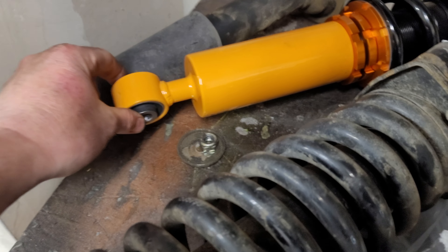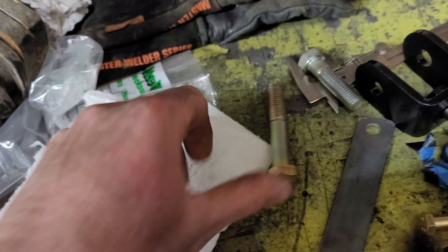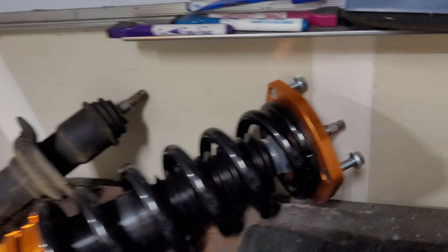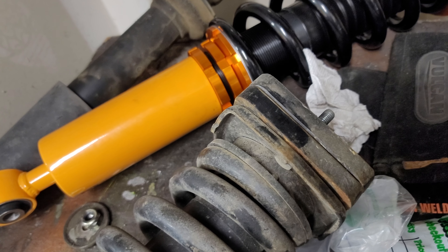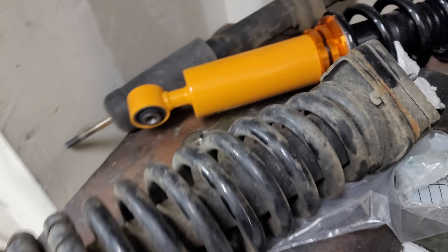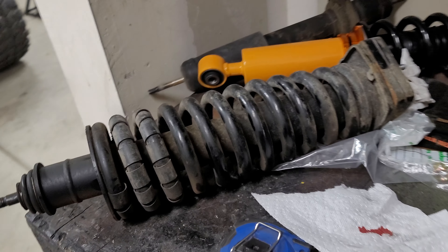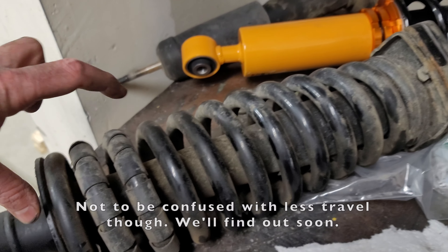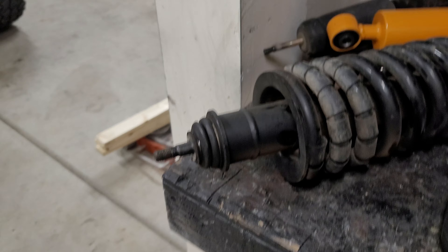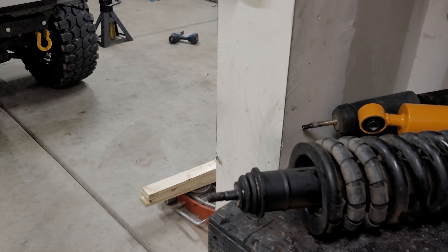Had to do some modifications — waller out this hole a little bit to effectively use good Grade 8 hardware, half inch bolts. Remove the top plate and install the factory Mercedes one. So no more blocks for me, done with that. Now will these factory springs carry more weight? Probably — I mean, that's just physics. The springs themselves are about a sixteenth of an inch thicker in diameter, and you've got all of this to spring on versus just a short bit. But for my purposes — off-roading and shit — the more flexible the rear is, the happier I'll be with it.